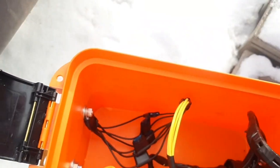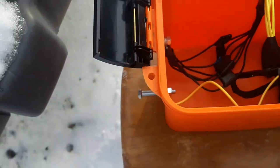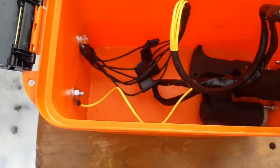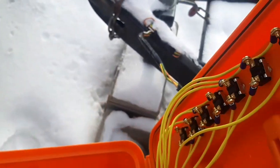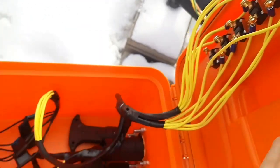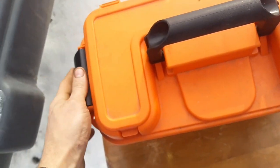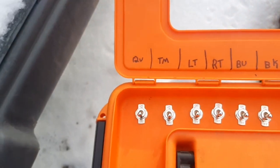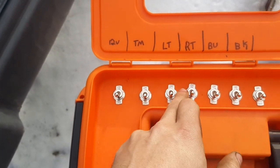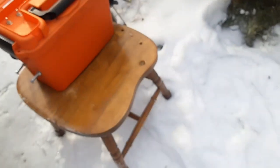The way I built this was actually very simple. You've got two bolts hooked up to a slew of wires — one slew of wires is all fused, six of them running up to six toggle switches. Power goes out to a seven-pin connector, one wire is my ground, close it off, keep it sealed. We've got 12-volt: tail, marker, left turn, right turn, backup, brake controller, and spare.